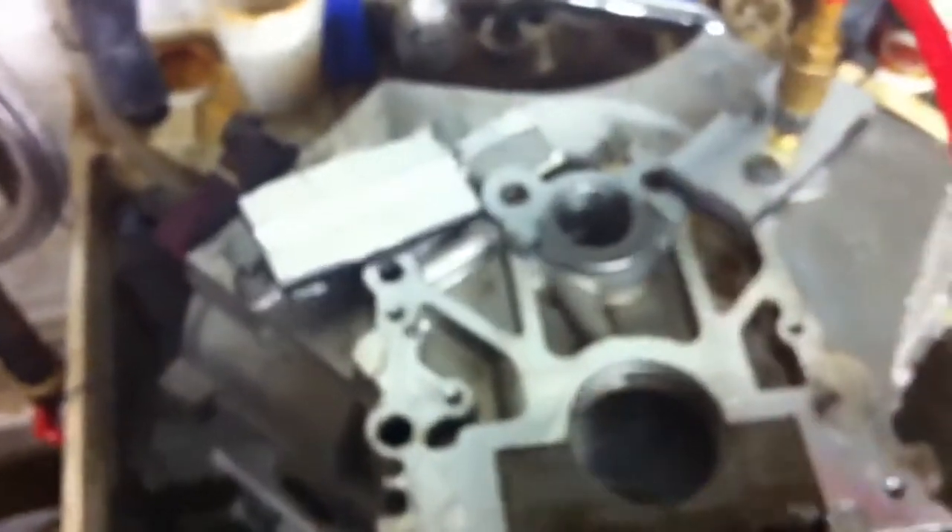At 35 psi, I have the block here in my utility sink. I'm only able to insert half at a time, but you can see there are no bubbles coming from the back side of the block. I'm about ready to flip it over. I'm going to put a spacer in here because this thing's pretty high, and then I can see if there are any air bubbles — so far so good, no air bubbles.